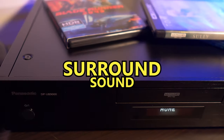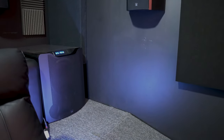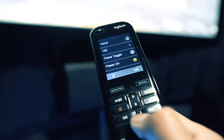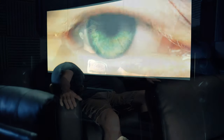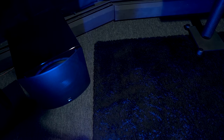For bass testing, I put on chapter 1 of Blade Runner 2049, using a PB-16 subwoofer. Even without room correction, the opening scene rumbles the hell out of your eardrums. But comparing correction on and off, bass was noticeably less boomy — especially in seats with an overemphasis in the lower region — and was smoother and tighter overall. Note that this version of Dirac only applies correction to a single subwoofer, despite there being two subwoofer outputs. Room correction also can't fix issues like dead spots or nulls.